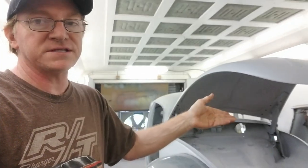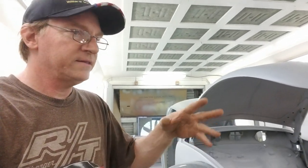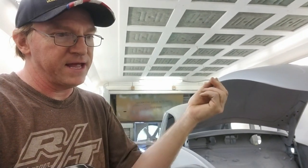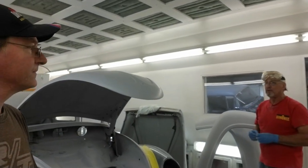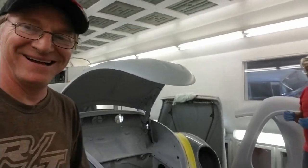Plus, you're going from a glass fender to a metal body, with the weld in the middle, it isn't going to hurt the work. The expansion and contraction, it's not like metal to metal, and then you have an area that you're leveling up. So it'll be pretty forgiving. It'll look good. Never had fiberglass match a metal body yet. No, but we'll make it work. Sounds good, Kev.